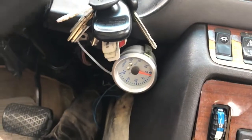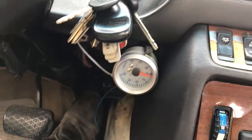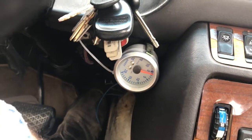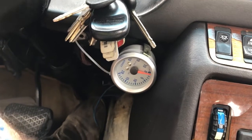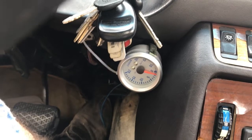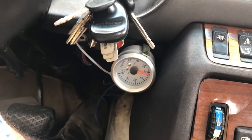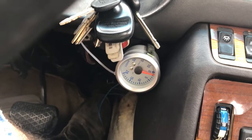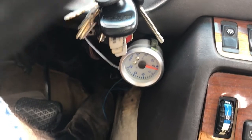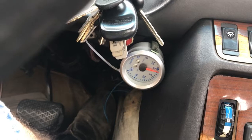We should be able to get over 10 easily. I rebuilt this turbo, so it's in good shape. It's just a spring in the wastegate — we need to adjust the spring tension and get it adjusted correctly to get a little more boost out of it. We should be getting close to double that. I need to look up the specs — I kind of think it stops at 13 PSI, if I remember right.